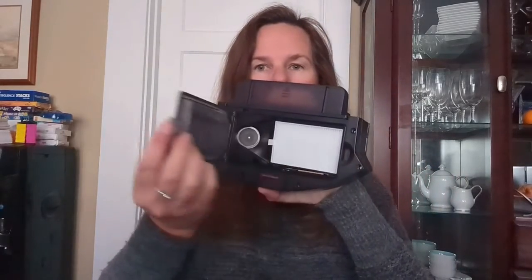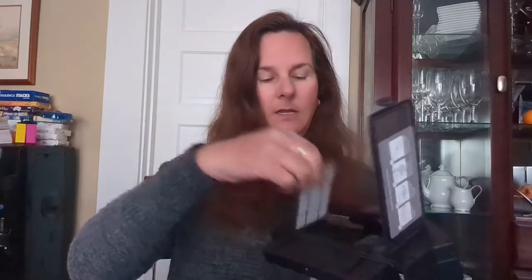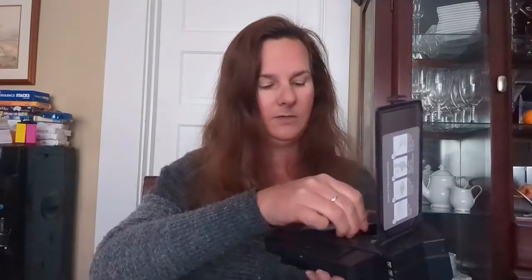You also have the little filters inside. Once you've emptied the dustbin, go ahead and close it back up. On top there's a nice little lever — you simply slide it open. Inside you have your main filter, which is the one you replace, and it does come with a replacement in the package. There's also a secondary filter underneath it that you can tap out to get most of the dust out. I do periodically rinse this one under the sink and make sure it is fully dry before I put it back. Then simply slide it back into place and close it — it's good to go.